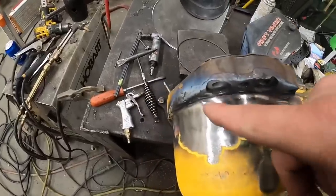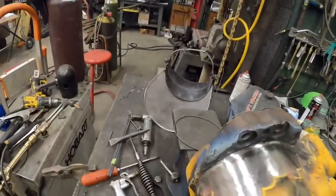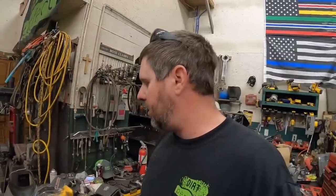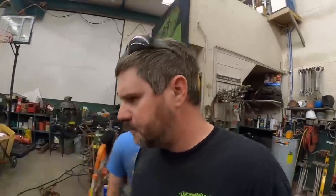Those couple little imperfections you see right there are not actually pits. So I took the slag hammer and kind of pinged it. By pinging it, you kind of expand that weld a little bit and kind of make sure it don't crack as it cools down. So we're probably gonna let this sit for a little bit. We may even come over here in a half an hour or so, throw a little bit of heat on that, even slow down the process even more. But the big thing is after it's completely cool, we need to inspect to make sure it don't crack right along our weld. That's what we don't want to happen. While that's cooling down,